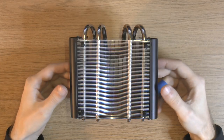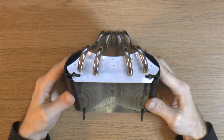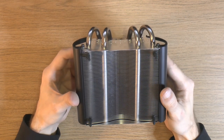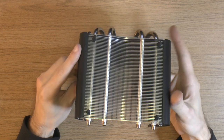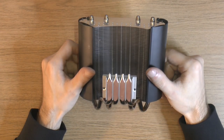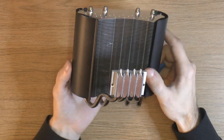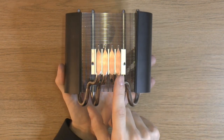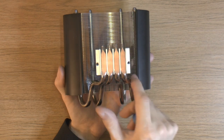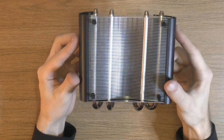So for CPU cooling, I actually have not the original AMD cooler, but the original cooler for the system the CPU came out of. So this is a Nexus HOC 9000 heatsink. It's a top-down blower style. So that's pretty good, I think, for the motherboard with the layout of the VRMs. The only thing I don't like is this old style of heat pipe integration here, where they just sandwich them all flat. Doesn't cover the full IHS, so kind of annoying. But it's not a bad cooler at all. It was fairly cheap, I think like 47 euros or something.